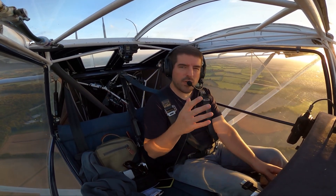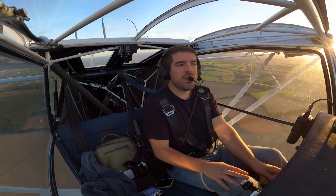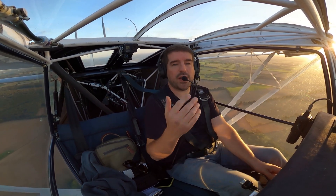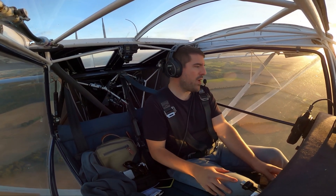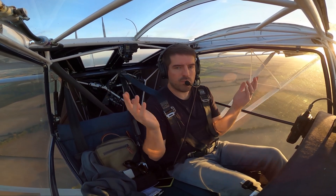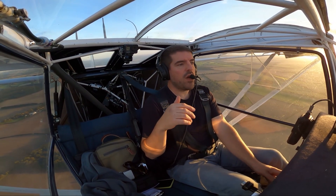So previously, the engine was running rough and it took a long time to start. There were lots of little niggly issues to the point where something needed to be fixed. I didn't really know what, so I ordered some carb rebuild kits, which was really for my peace of mind anyway, because I'd never taken my carbs apart. I didn't really know what was going on inside the carbs itself. I was personally surprised — most of the parts all looked absolutely great.